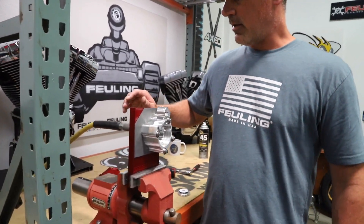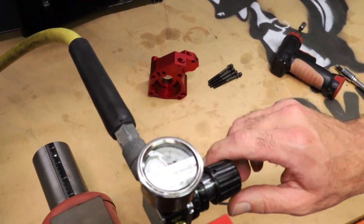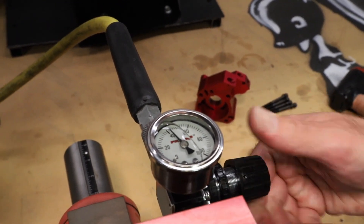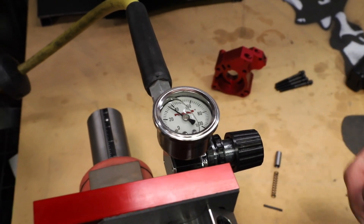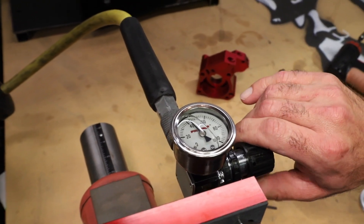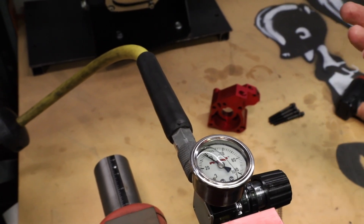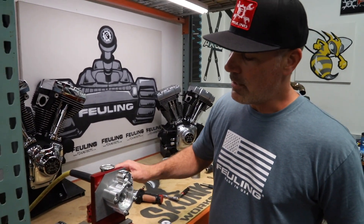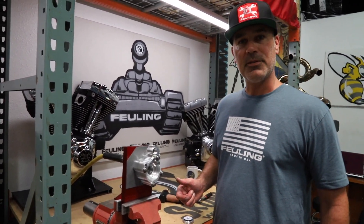This is an oil pump that's already been pressure tested. You can look at the gauge up here and see where the valve opens and then reseats and recloses. That one popped off at about 70 psi and it hit the seat at 40. Generally, if you work it back and forth a couple of times on a brand new spring, it will take seat. I would say that oil pump is in perfect condition, ready for final assembly and installation. But if the valve is leaking, I'll show you a couple of procedures to help seat and seal it.